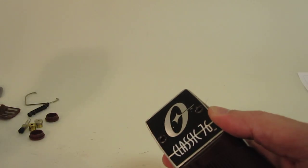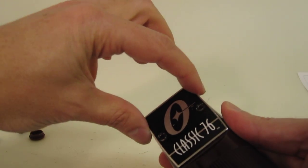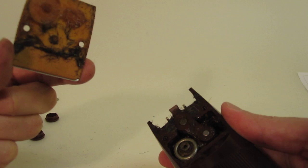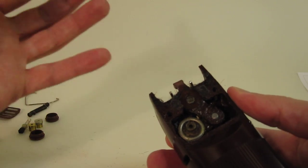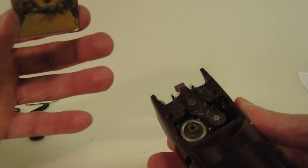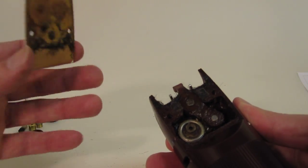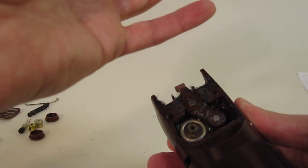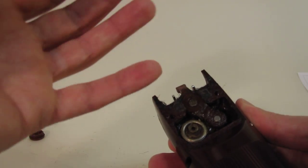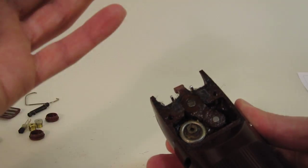Very softly and gently, you can take the cover off. In this case, you can see hair. I don't know why these get pretty dirty, so it's probably not a bad idea to use various Oster cleaning products. You take the cap off, use compressed air or whatever to clean it out, and then you can also get grease to re-grease it and such.